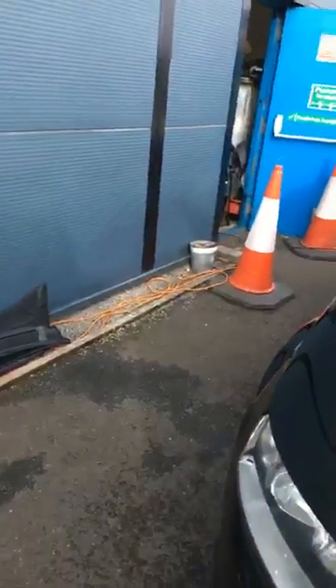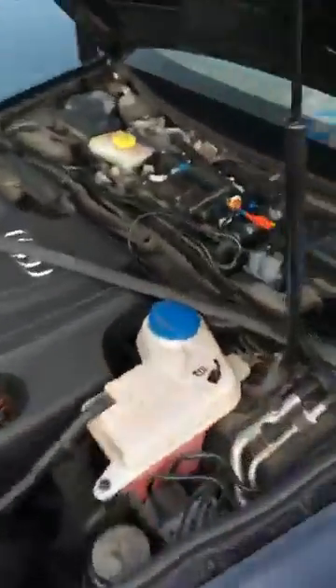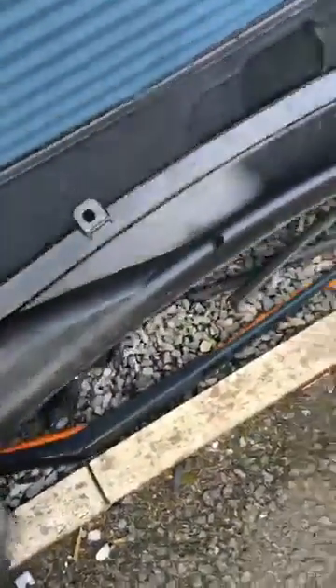We're back — has my hair gone grey? We're having a run around with this. Let me tell you where we're up to. We did a global scan before. The blower motor is not located under there on this model — it lives there. So you've got the blower motor and the blower motor control module. To get at that you've got to take the trim off the bottom of the windscreen, which is always a twitchy moment when it's cold — but we've managed to save the windscreen this time.